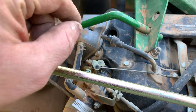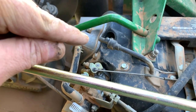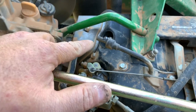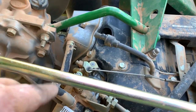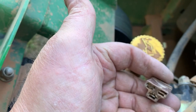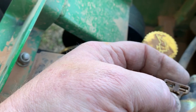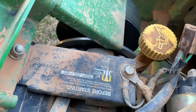Even though it's sparking, when it revs up to a certain point it just loses spark. I'm going to try to film this so you can see it — I'm going to crank it up, it's going to be arcing between the spark plug wire and the spark plug terminal. Now I have the engine isolated from the machine, so when you unhook this connector here, this black wire is the kill wire to the coil, so there's nothing downstream of the engine that could cause it to lose fire.